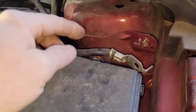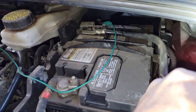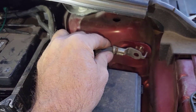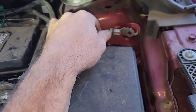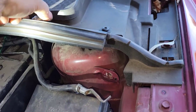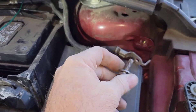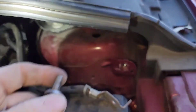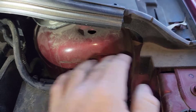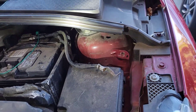The thing that people don't like is that this is the entire ground for the car. Other than that, there might be another electrical wire over here, but this is the main one — it starts through this, it charges through it. The issue is there's no metal-to-metal contact. All the contact is the bolt through the washer into the bolt and into the threads — that's it. So people are just saying they're grinding off the paint and putting that back on, and it's making a little bit of difference, with a little less craziness.